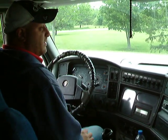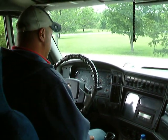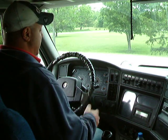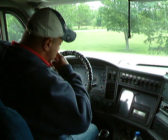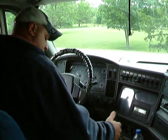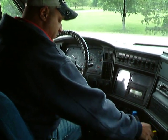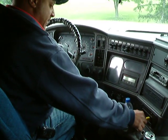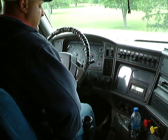You've got the air leakage rate test, the static brake test, the low air warning test, and the spring brake test. Make sure you've got over 100 psi — we've got 125 psi right now, which is great. Before you start this test, put your truck in gear to keep it from rolling. If you roll out of the way on the road test, you're going to get a dangerous act and a fail. Call out the test you're going to do first, then do it.